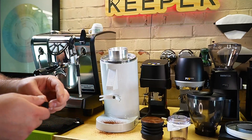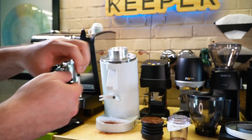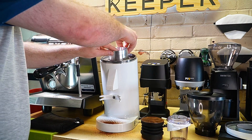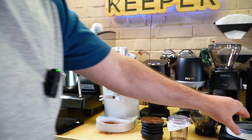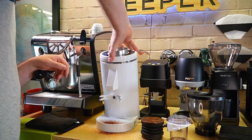There are these wedges — we have another video on those. They are narrower on one side than the other; the narrower side goes down. Put these back in, and if you don't do this, your burr might be slightly crooked as you use the grinder, and you're going to get a little bit inconsistent results. And then we're just going to put it back together.